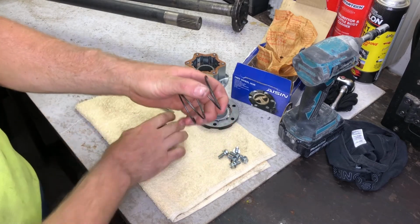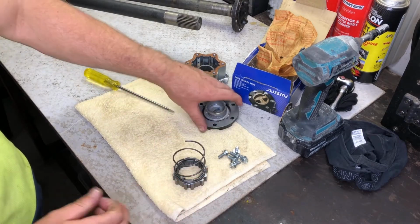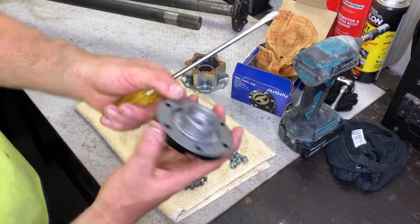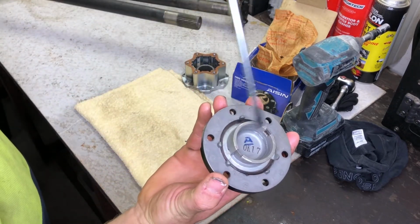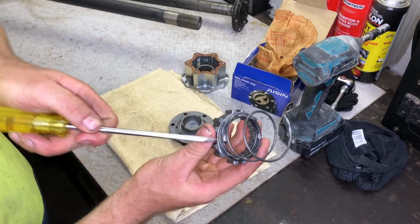The larger spring has an end with a smaller opening, and this is secured over the top of the clutch assembly. The back of the control handle has these cutouts, and they are to accept the larger tabs on the inside of the pawl.